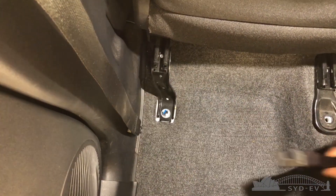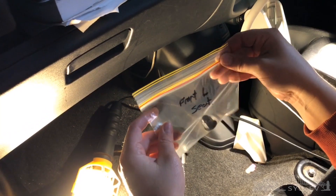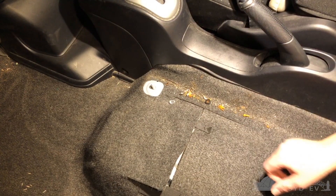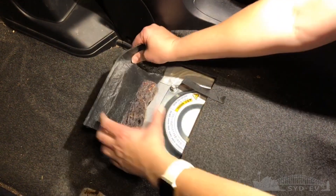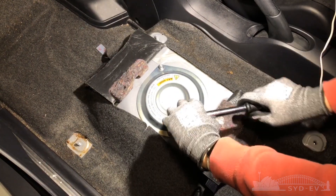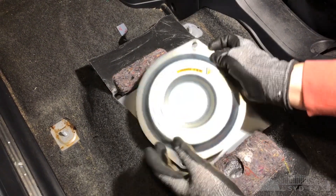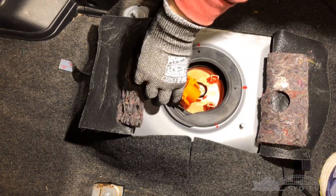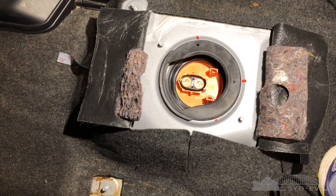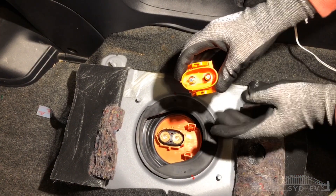Now the 12-volt battery is isolated. Next comes what could be the most profitable or scariest part of the job — removing the front seats to access the drive battery isolator plug. Under the left-hand front seat you'll find a metal plate held by only two fasteners. Underneath that is the drive battery or traction battery isolation plug. Flick the little orange lever, remove the plug, and you're now a lot safer from being exploded by 330 volts and 300 amps.